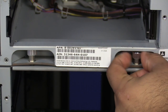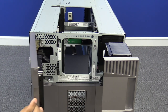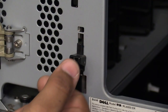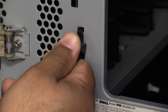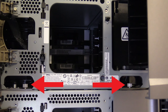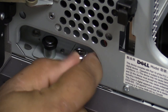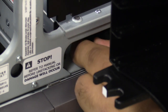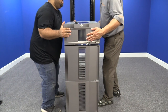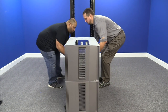You are now ready to move to the front of the library. In order to access the picker tracks in the front of the control unit, you will need to open the main access door if you have not already done so. You will see the same type of black squeeze clip to the left of the main opening. Using the same method as before, raise the track so it is locked in place. Now undo the thumb screws that are holding the front of the control unit to the expansion below it — they are located at the bottom of the control unit, below the main opening, and can only be accessed while the main access door is open. Undo both thumb screws. Once this is complete, you will be able to remove the control unit from the expansions below it. Lift the control unit off of the expansions and put it to the side.